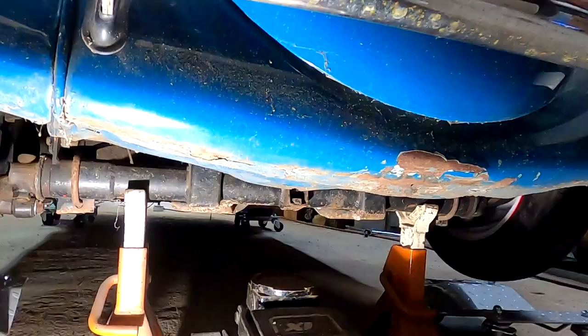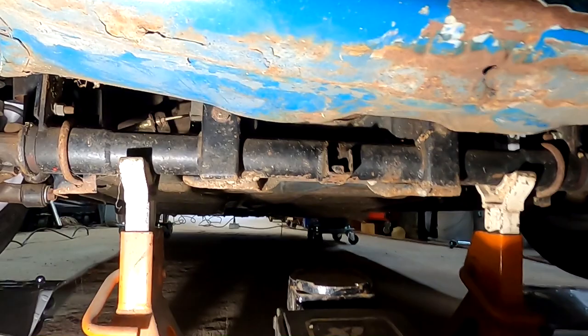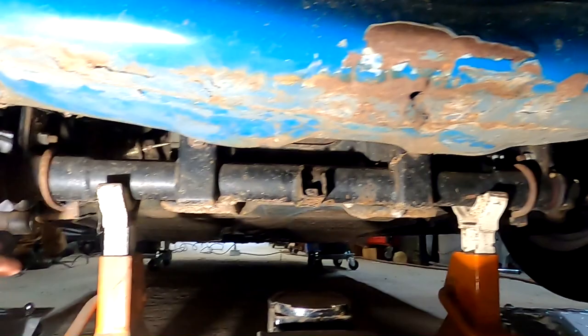On the front end of a Volkswagen they're pretty easy — you don't have to worry about it from side to side of the beam. You can see it goes all the way across. You can tell I drive a little low — it's a little beat up over there. We're just going to place the jack right here in the middle of the beam and pick it up.